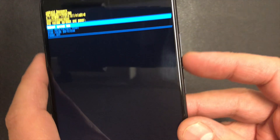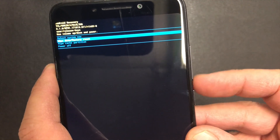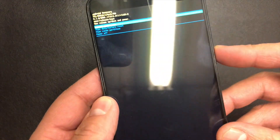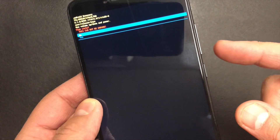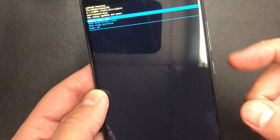When you press that, the factory reset or Android recovery screen comes up. You will need to scroll down with the volume down key to where it says 'wipe data factory reset,' press the power button, then scroll down and press 'yes.' Once this is done, you're going to wipe the cache partition as well — scroll down to 'wipe cache partition,' press the power key, scroll down to 'yes.'